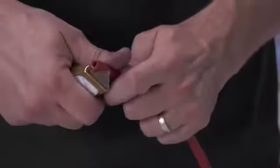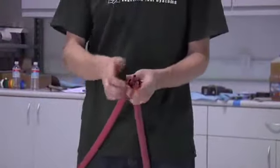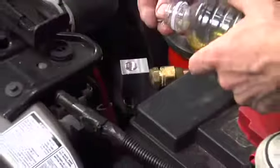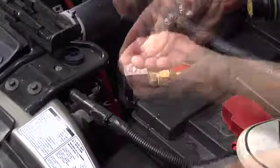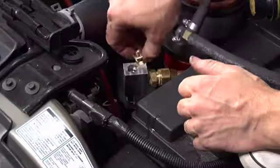Next, taper the end of the PEX line, lubricate with oil, and insert into the cut length of the first coolant line. Insert the PEX line, leaving a minimum of 12 inches hanging out on either side. With the PEX line inserted, reinstall the first coolant line. Using some vegetable oil, lubricate the O-rings and the compression nuts.